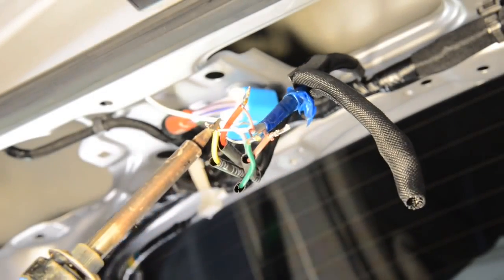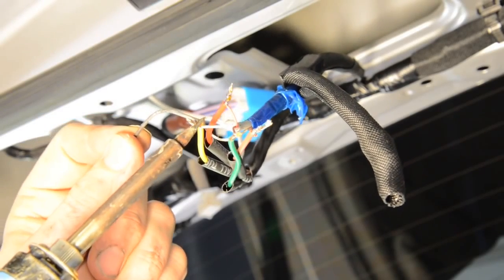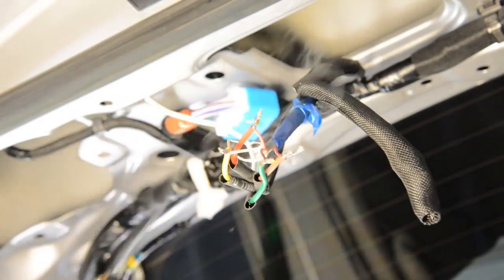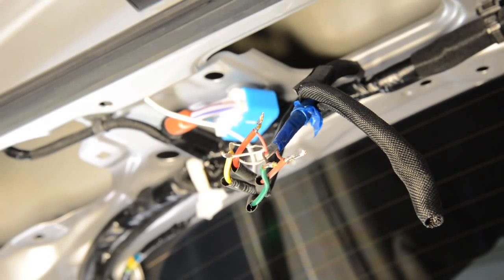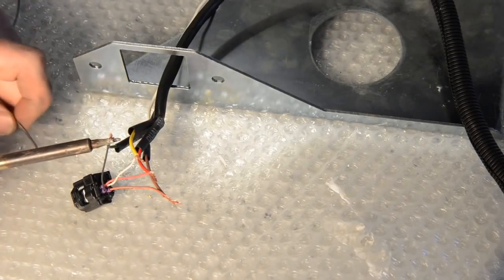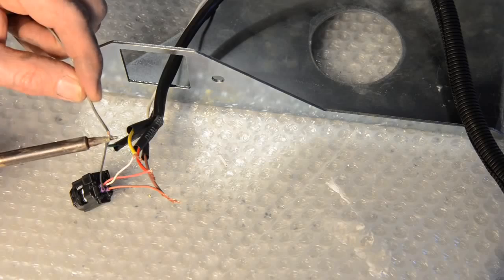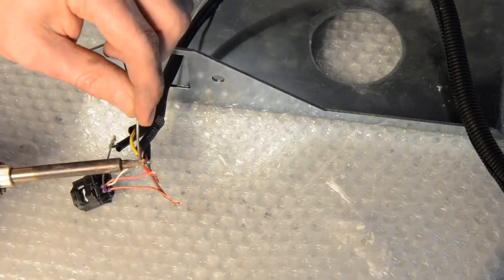Cut the plug off the factory loom, leaving at least 50mm of wire on the plug, then set the plug aside. You can then solder 4 of the wires onto the camera wires in the tailgate and insulate the connections with heat shrink tube. The 5th wire is a surplus. You can then solder the camera plug onto the other end of the 5-core cable out on the wheel carrier. Make sure you connect the plug with the corresponding coloured wires used in the tailgate end of the wiring.